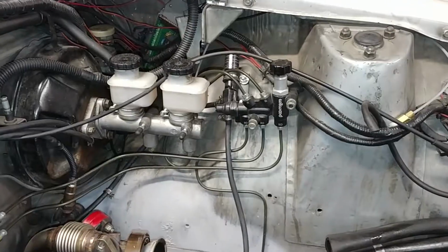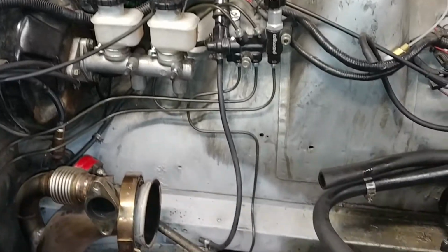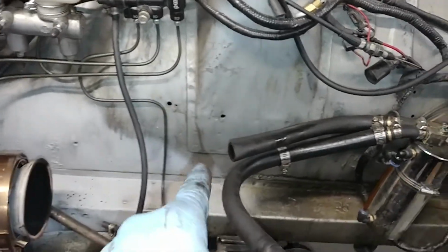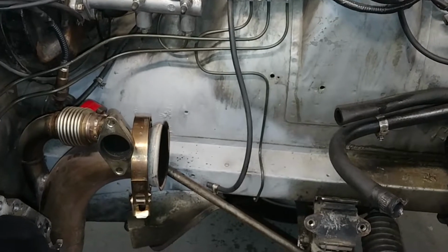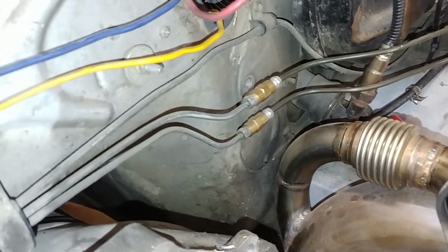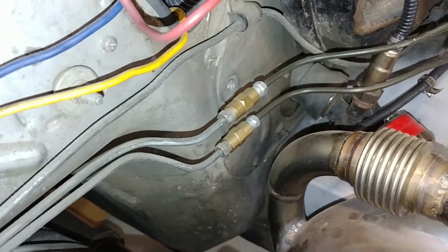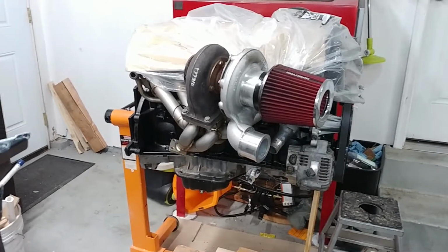Well, for my engine, no. And if you guys notice that, I've got my 1-inch master cylinder on there. And then I had to run a separate proportioning valve because the turbo was too big. Not bragging, but it was too big. So the stock valve that they had right there, those two little areas are the holes. It just wasn't fitting. The turbo was sitting up against it, and I don't want my brake fluid to be boiling. Thankfully, this guy's been in the desert its whole life, so I was able to reuse my stock brake line there. Just got a little union in between there. Flared the end with a tube nut. Tightened her up. Again, thanks for watching. I'll get that valve cover painted and the intake manifold all squared away.